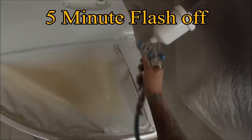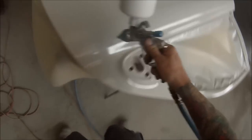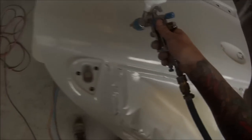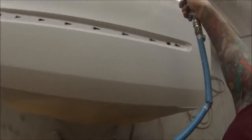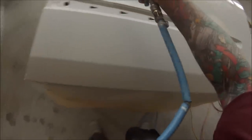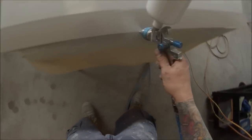You've also got to talk to the guys you work with or just talk to some guys in the trade. You're also more than welcome to check me out on Facebook and send me some photos of jobs you've got — I'll do my best to help you out. But what I was getting to is you've got to decide the best way to paint strip a panel. Sometimes you're better off doing it dry just with the orbital sanders, sometimes wet with the paint stripper, and sometimes you're actually better off taking it down to the sandblasters. We don't have a sandblasting shed here and most panel shops don't either. But it's not too expensive for stuff like wheels that you just can't get into all the grooves — it's easier to sometimes take it to the sandblaster and pay them a little bit of money.